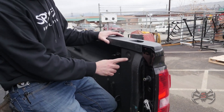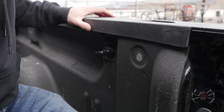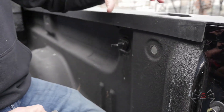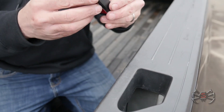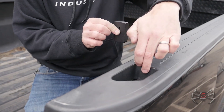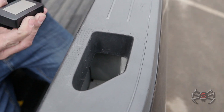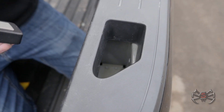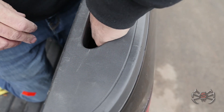We're going to go ahead and install the rear hoop. On a Chevy you can often see a little plug for the inside hole, so we're going to pop that out. The stake pockets and the plastic don't line up the same, so we provide a filler block so the plastic and the metal down in there are in line. We're going to take the cover off the sticky tape and then slip it down in forward towards the cab all the way, and stick it up against the truck. We'll do the same thing on the other side.